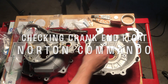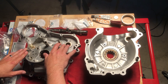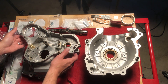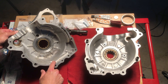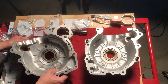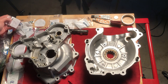As we saw in the last video, the bearings are in and ready to go. From the previous videos we looked at the plug situation, so now I've got both plugs on this side fully inserted with a little bit of JB Weld — you can see where I punched them in to retain them hopefully permanently. There's also another plug on this side; it's a tricky, difficult position. There's a lot of JB Weld behind that that will never come out. You can see all the new hardware for the crank cases — all brand new hardware from Andover Norton and from Old Brits.